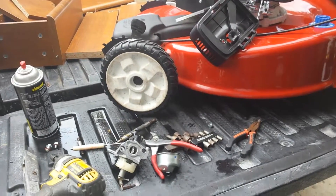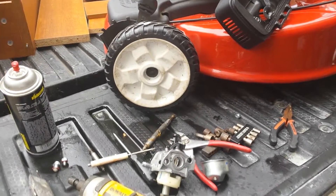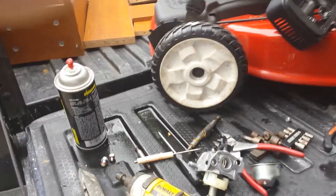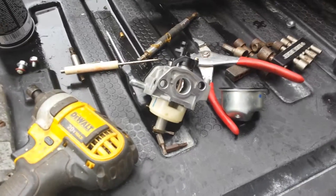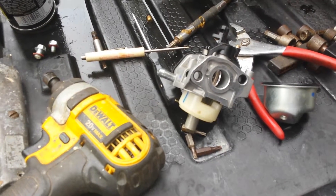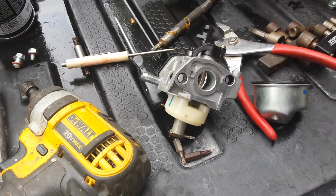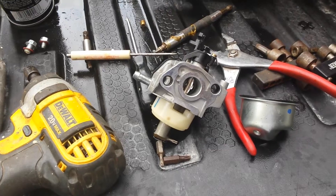This is an almost new mower, but it's beyond the warranty. Gasoline with ethanol is so bad for carburetors. This is what happened — I am cleaning up the carburetor. I see a lot of clogged up areas because that ethanol will make corrosion inside this aluminum casing, so hopefully I was able to open up all these jets.